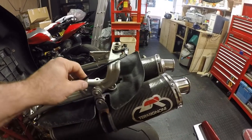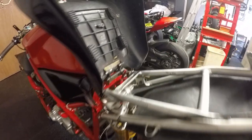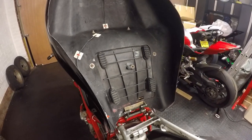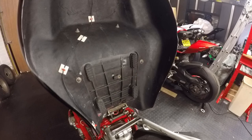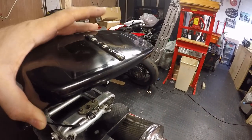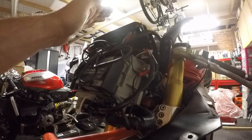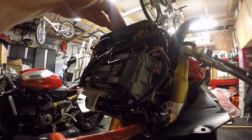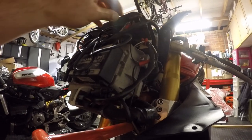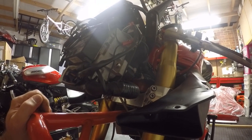The rear end seat unit is a standard aluminium frame from Ducati — it's the same one that comes off a 748. It's running a carbon under-tray. I actually like running the standard Ducati seat, so I don't buy my race bodywork with foam seating — I prefer to use the proper seat. In the current config it's running an LED rain light. All of the electronics for the bike are held at the front, with the AIM MXL Pista CAN-based dash logger mounted on a carbon frame using a 996 RS carbon fibre frame support.